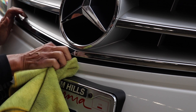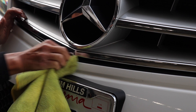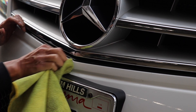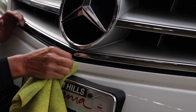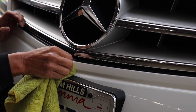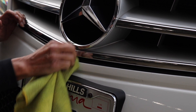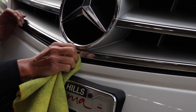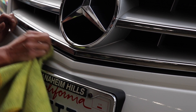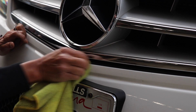Some people worry that rubbing too much will take off the clear coat, but that's very difficult to do by hand. The damage that's there is the damage that's there. If you continue to rub, one of two things happens: either it's truly damaged paint exposing black plastic — in which case touch-up paint is needed — or it's mostly transfer. The more she works at it, the more it disappears, because it's more transfer than an actual scratch. Standing back at normal viewing distance, it essentially looks perfect.